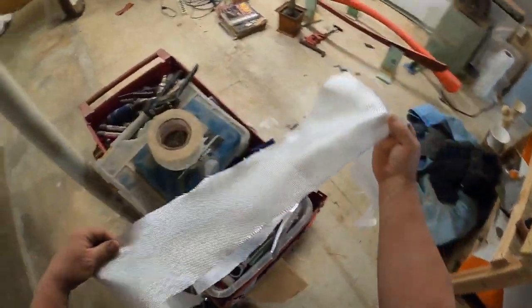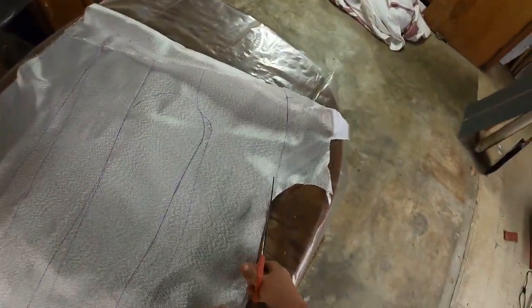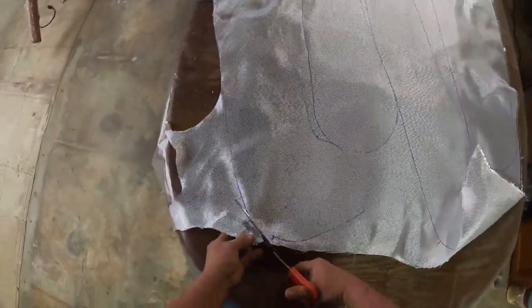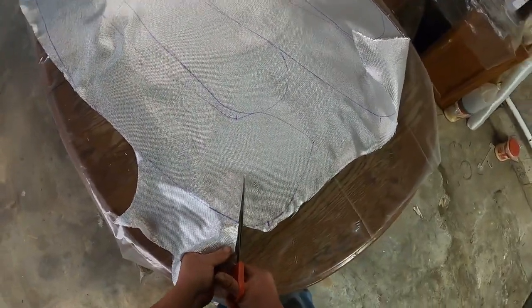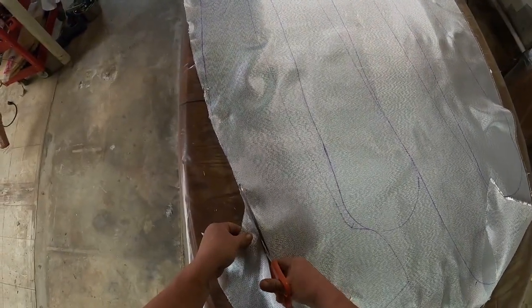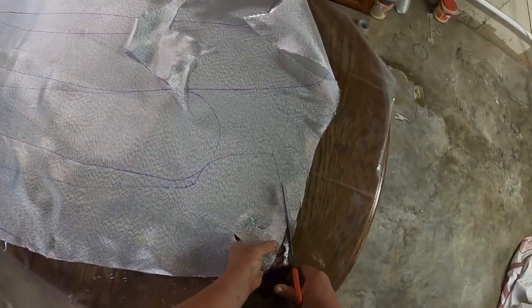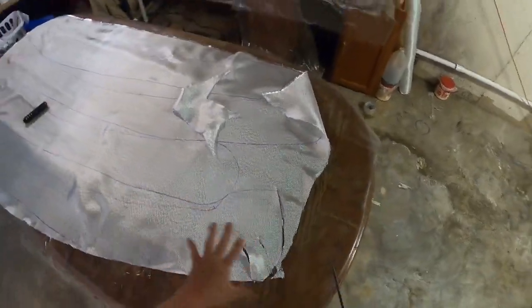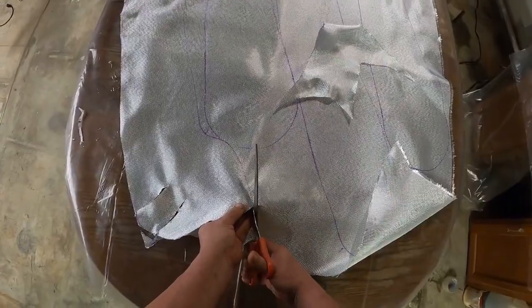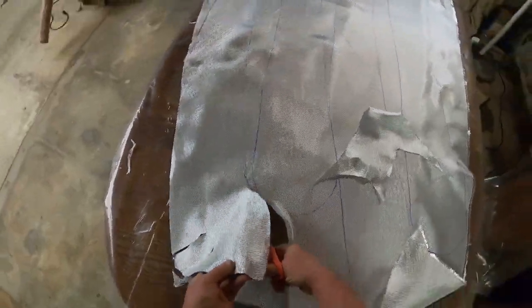It is what it is. I'll lay this out and bring this over. I guess because I'm right-handed, sometimes it's easier to cut in certain ways. These cuts here don't have to be exact either — they're just reliefs for the turn that it makes. And then I've got to make some little triangle pieces to go in. I just found it's easier if you trim most of it off; if you leave a lot extra it just gets in the way. This area right here wants to fight when you lay the fiberglass in there — it wants to wrinkle up.